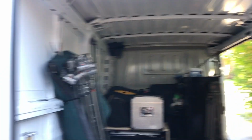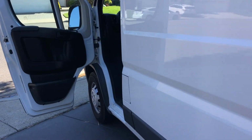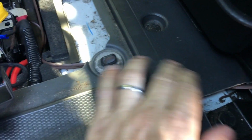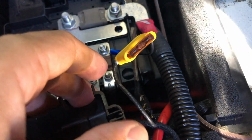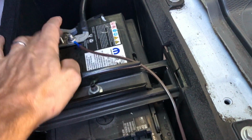All right, show you my wiring. I'm just running off the engine battery until I get the house bank purchased. So I ran a speaker wire, or sorry, lamp cord, 16 gauge. It's about 21 feet of cable run. Just one under the seat, just under the floorboard in this one little section. Got an inline fuse. I think I only need a 4 amp fuse, but I went 7.5 in case I want to add some lights on that same circuit. And then I just tied the ground into the battery terminal.